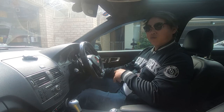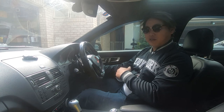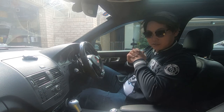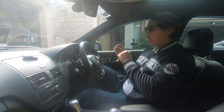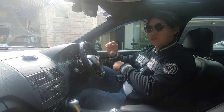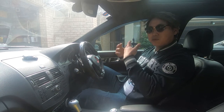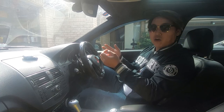Now, without taking your foot off the accelerator, you turn off your car without removing the key, and then you release your foot off the accelerator pedal. You do not remove the key from the ignition and you do not take your foot off until you turn off the car. Now all we have to do is wait two to five minutes for this procedure to initiate, then start the car and go for a drive.